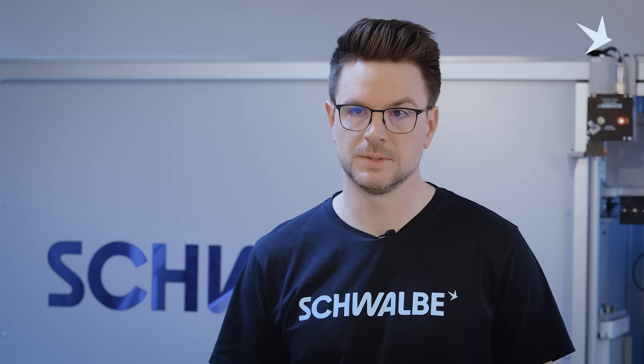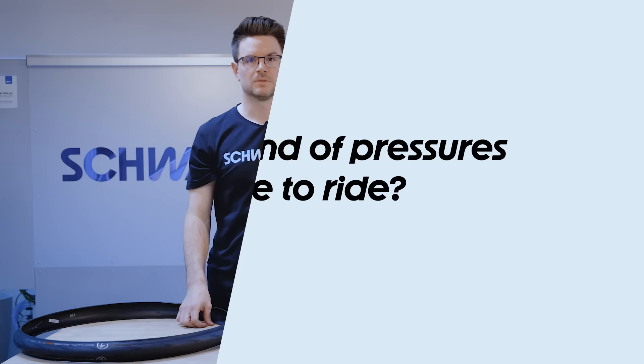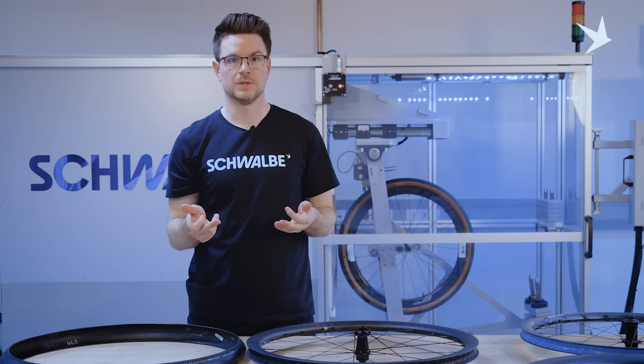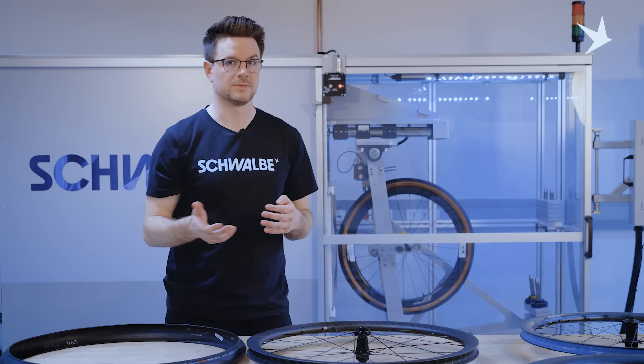The choice of tires is furthermore limited by the manufacturer of the hookless wheels themselves. So if you ride a hookless wheel you will have to get information from the brand about which tires exactly are compatible with your wheel. Speaking for Schwalbe tires, it is mandatory to use a tubeless tire on your hookless wheel even if you use an inner tube in your system. Generally, our maximum pressures are indicated on the tire itself — you will find an engraving on the tire — but you will also always have to consider the maximum pressure of your wheel.